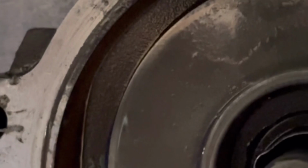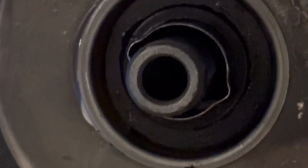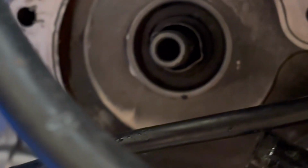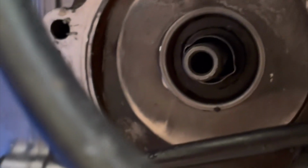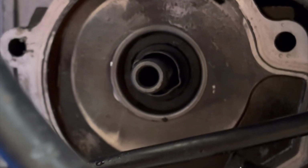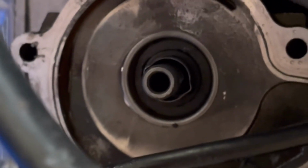So here we go. Yeah, you can see, if I get my pointer, where's my pointer? Can't find it. You just have to bear with me. So you can see an inner circle there. That's kind of part of the washer system that needs to be pulled out. So you get some pliers, and that's where the problem is causing, because coolant's getting beyond this gasket seal and then dripping down underneath the housing. And I believe behind there, you see, we have oil. So do I drop the oil first? That's a good idea. Let's drop some oil out.